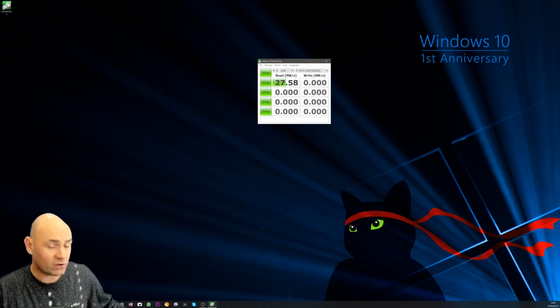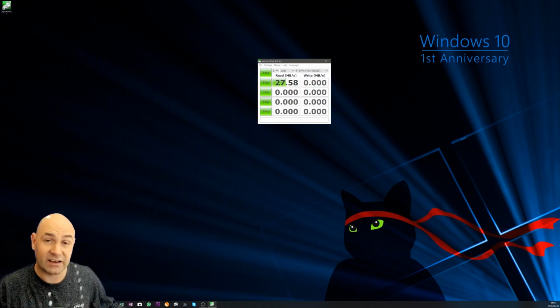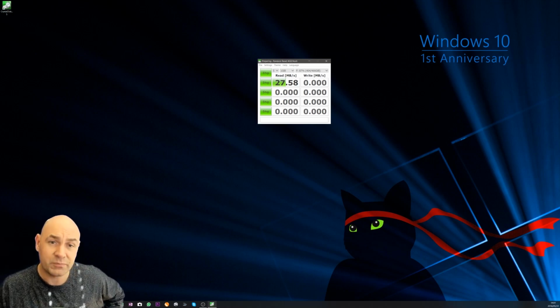That might, however, not be a SATA 6 drive in there. That's entirely possible. It might be a SATA 3 or something. I don't know where that drive came from. I think it was from a notebook. It's unlikely, though. We'll see in the next read if it gets 100, then we know it's not a SATA 3. It just happens to be a very slow drive. Okay, whatever. That's just mind-numbingly sad.